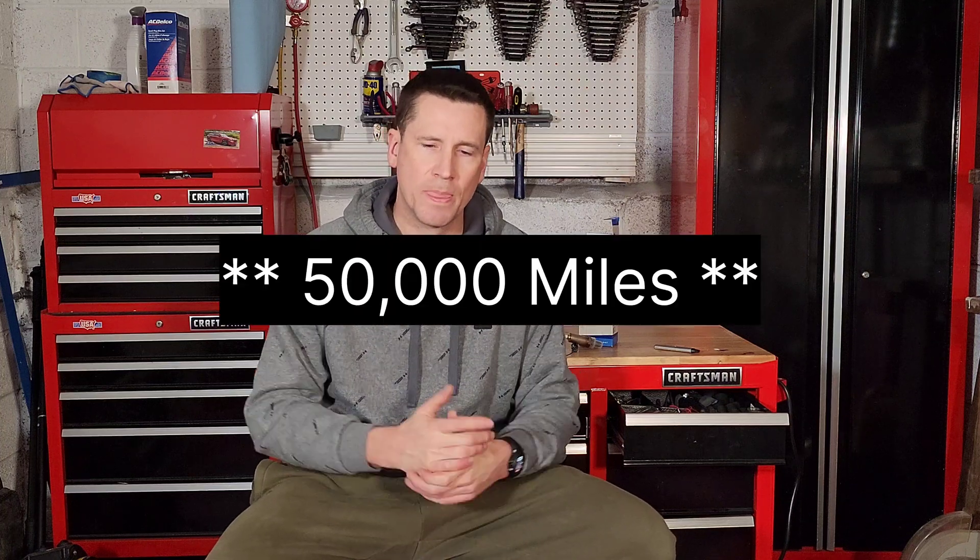Now let's talk about replacing yours. When should you replace it? There are a couple of reasons. Number one, if you've just bought the car and have no idea the history of the oxygen sensor, I strongly recommend replacing it. Number two, every 50,000 miles or so I strongly recommend you replace it. In 1981, General Motors put in their service guides that they should be replaced every 15,000 miles; from 1982 onward they called them lifetime sensors — but if you work on an older car, you know that nothing at this age is guaranteed for life.